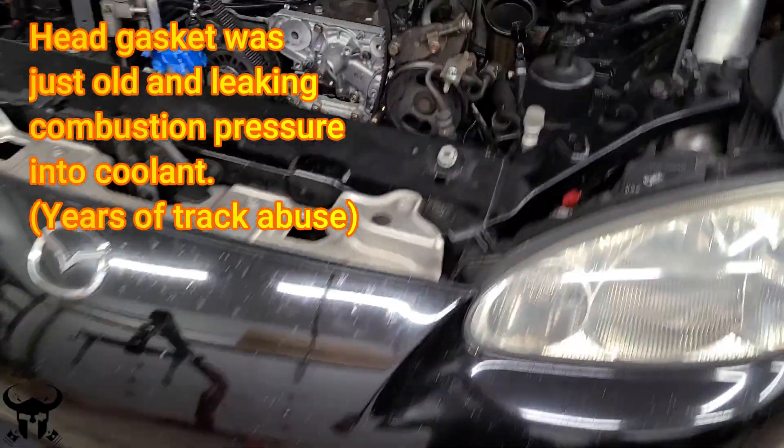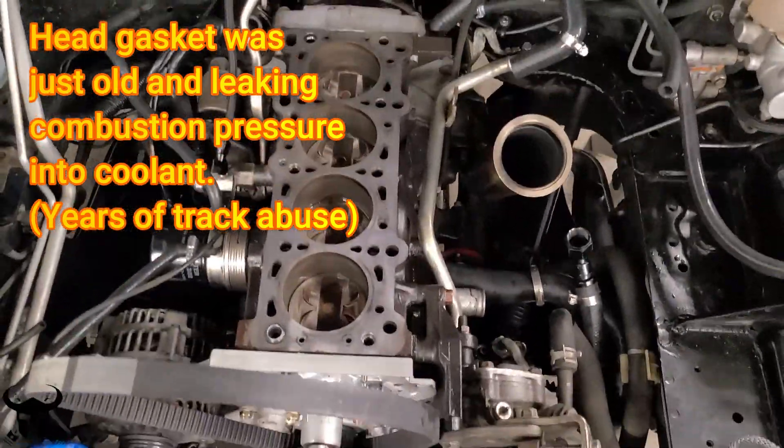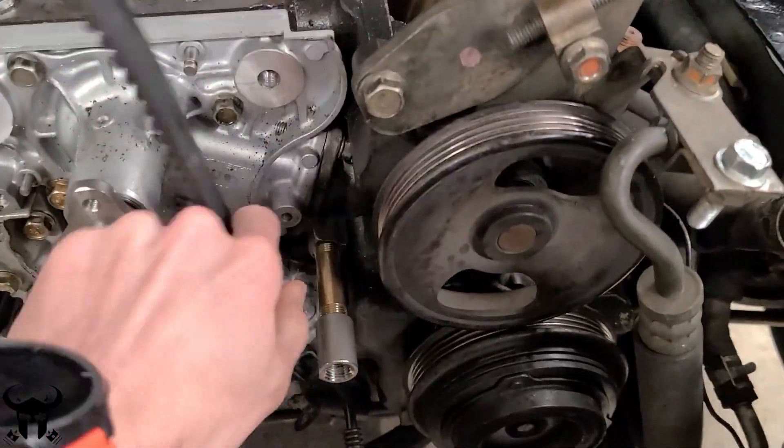Update with the Miata — it's not in the lift anymore. I got it running really well, I got it tuned, it was running great. It did a virtual dyno at over 200 horsepower. I was tuning it and then I started to do pulls to fill in the rest of my VE table. And my coolant was pressurized — my coolant lines were seeing a lot of liquid and vapor leaking out. So I was tightening some of those up, but I think what happened is my head gasket blew. I had turboed it and driven it around for like 30 hours and was getting the tuning just dialed in. And this fitting right here blew out.